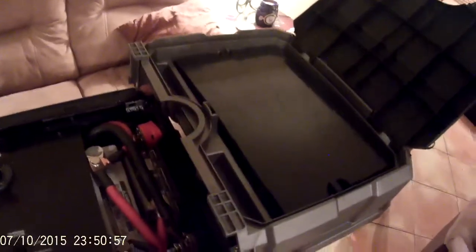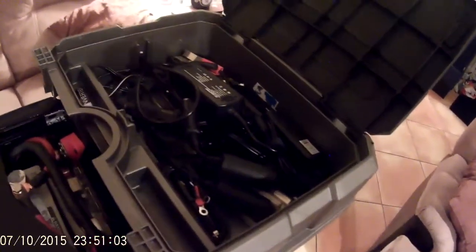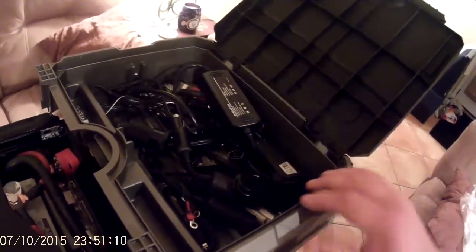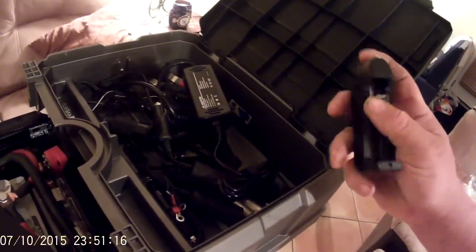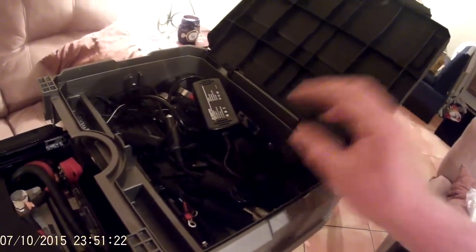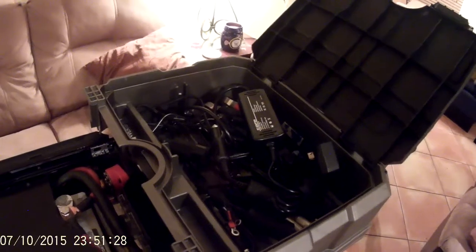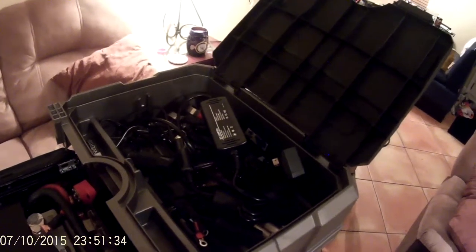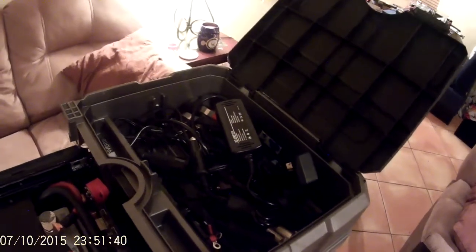In this compartment I'm in the process of building a little double-decker storage. I've got 12-volt adapters for several different things — my laptop, CPAP — and I've actually got one ordered to charge my 3.7-volt flashlight batteries, because I don't want to use the inverter more than I have to. From what I've read, you can lose up to around 30 percent when using an inverter.